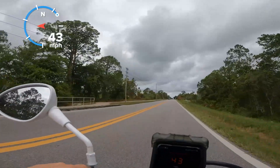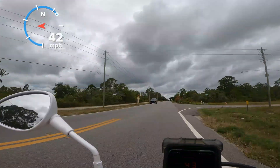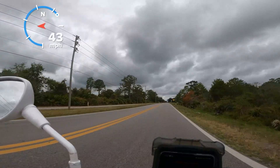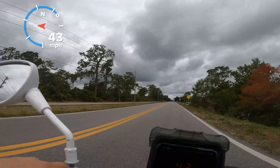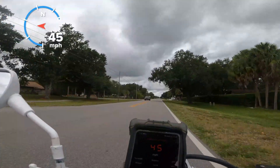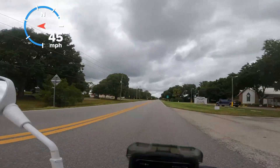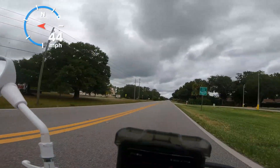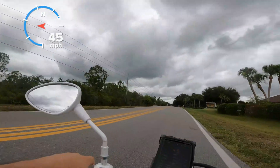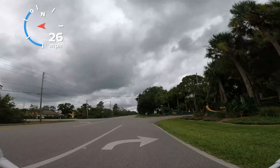So what I think I'll do to make RPMs — I don't want to put lighter rollers in it because it limits my top speed. I need to make more power, burn more fuel. I think I'm going to try to increase the jet on this carburetor to get more RPMs. Right now it feels great — I think I like these rollers. These are 4-gram rollers and they seem to be doing the trick. I just need another 1,000 RPM on top of this and I think it'll be perfect. It's so nice to be able to cruise on my 45 mph road, stay with traffic, and not be the guy in the way.